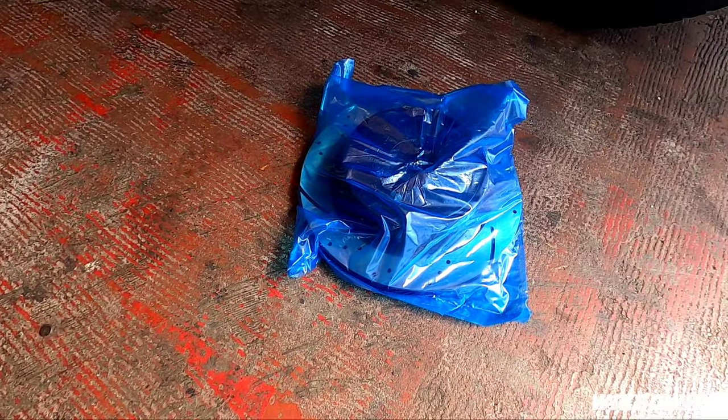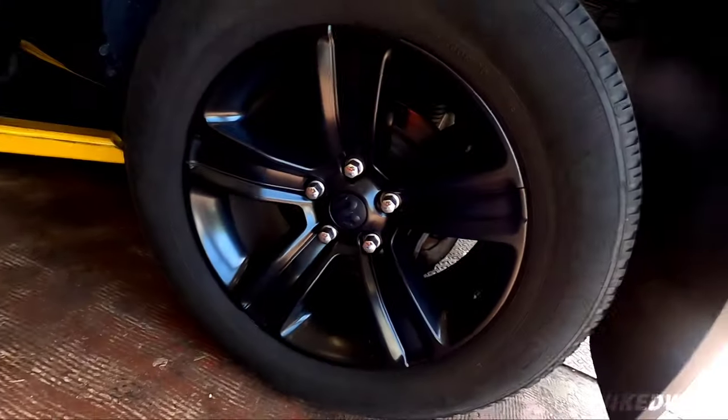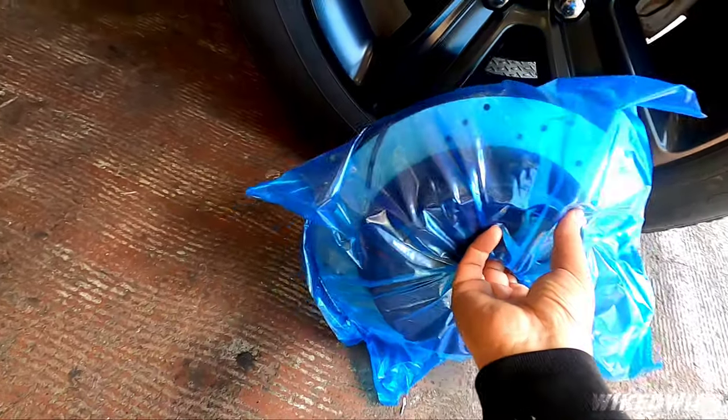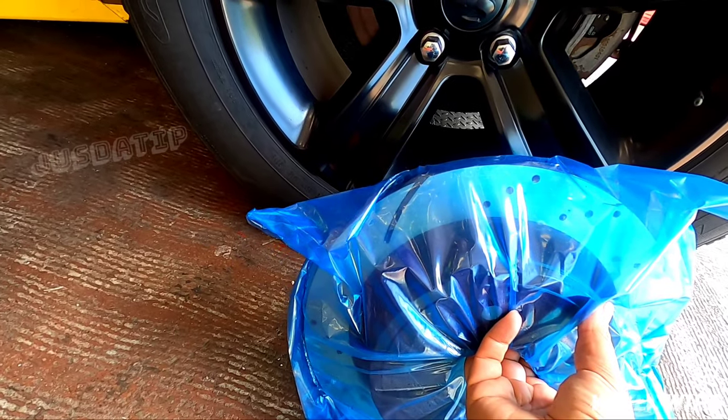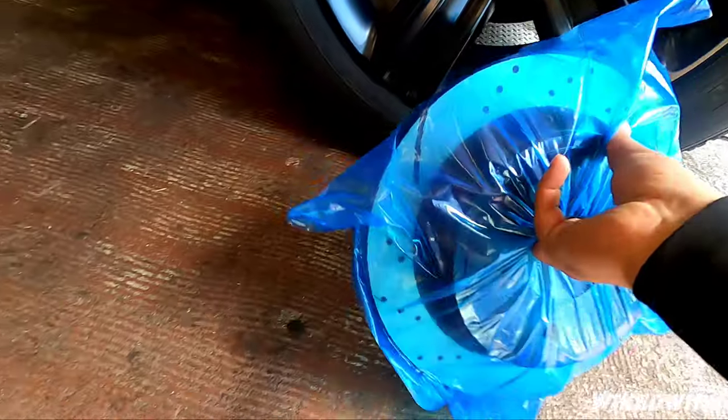He's just putting the rotors in the spots — these are the rears. As I discussed yesterday, the points always go towards the back. So when you have it lined up, the top of that slot is facing towards the rear of the vehicle.